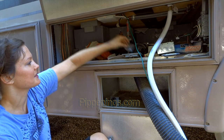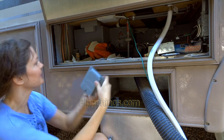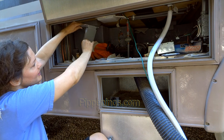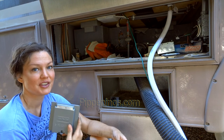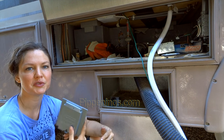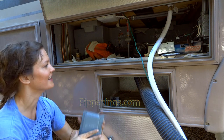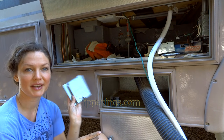I'm putting this face on it so that when I don't have it plugged in it'll have a little bit of extra protection. I'm going to position it this way so that when my cord is plugged in there's kind of a little wall — just a little bit of extra protection. This doesn't actually fit correctly with the J-box I'm using; this is a waterproof cover and the J-box I'm using isn't waterproof. So in a way I'm adding extra protection on something that's not waterproof anyway, but it's still going to be a lot more protection.